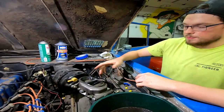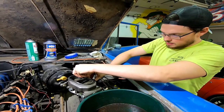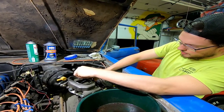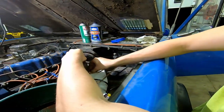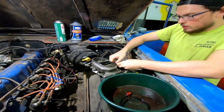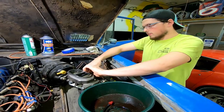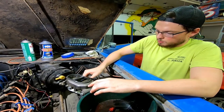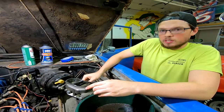It's bolted up, so I'm gonna come in here and take these off, toss them in here, and try not to make a mess with it. Also get the next one in quickly. I also have the far side open so that when we start to bleed it out the fluid will just flow down there relatively easily. Once the fluid is there, then we can start going through the actual brake bleeding process, which will be quite long because all of these lines are brand new and have no fluid in them.